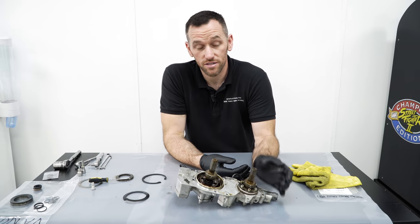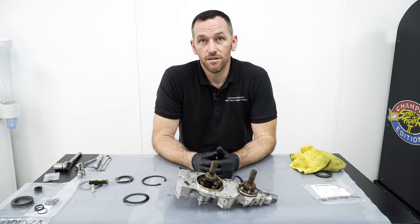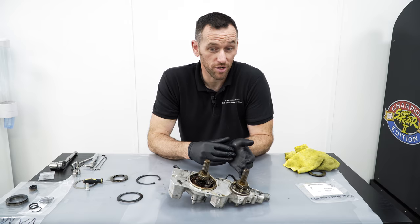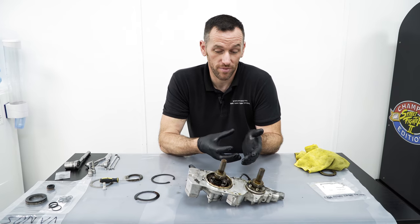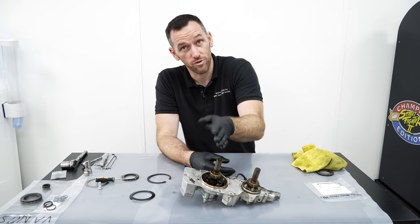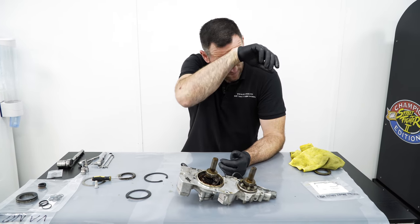and they generally don't fail now. So, I've noticed looking at when we do S55 stuff, it has nothing like this kind of unit. No. Now it's all internal. Without taking one apart, which we haven't done, we don't fully understand what's in there, but it uses engine oil pressure and it rotates the cam in pretty much the same way, but on the chain wheel itself, rather than using a separate spline gear to push the cam around. Yeah.